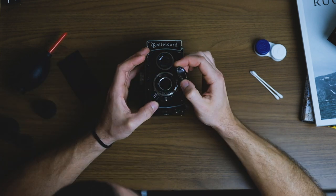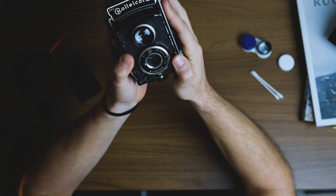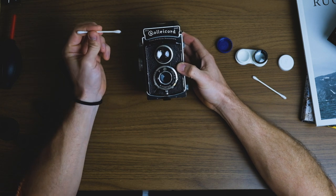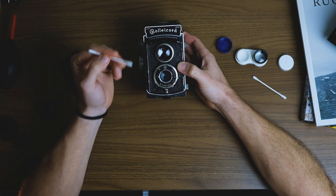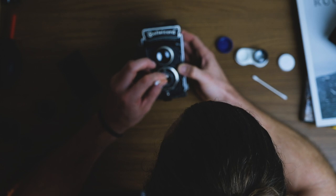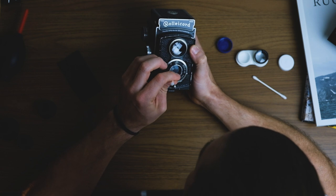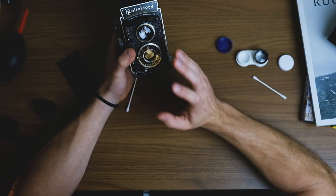There's a little bit of discoloration — it's not rust, but it looks like it's just been rubbing. We're going to take just a little bit of lighter fluid and very delicately clean the shutter. Don't press too hard — you don't want to bend anything or dislodge anything. You just want to very carefully wipe it down, then dry it off before working the shutter in and out. You want to go with the shutter, not against it, and avoid moving those blades out of place. If you see the fluid pooling, you're using too much — make sure you dry it off before it gets stuck in the element and makes things worse.